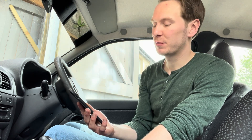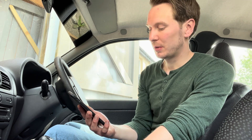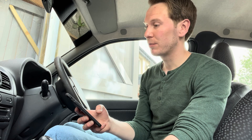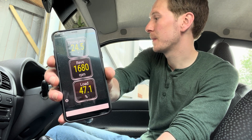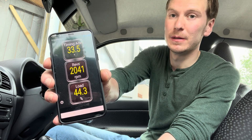What we should see is the timing advance jumping back to roughly around 3 degrees ignition on hydrogen. When I've been using the Nology ECU I have it set to around 5 to 10 degrees timing advance, which isn't a great deal at all. If you want to increase power you could advance it more, but that risks engine knock when running on hydrogen. So here's our baseline — we'll get it to 2000 RPM — that's our timing advance on petrol. Let's take it from there.